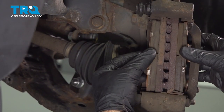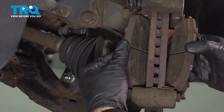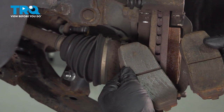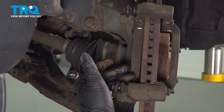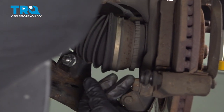So we might drop it down just a little more and ease that bend. Now with our caliper out of the way, we can go ahead and take out our brake pads. And from here, our caliper bracket is going to come off so we can get to our rotor. Our two caliper bracket bolts are going to be 19 millimeter.